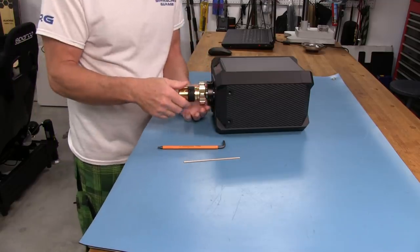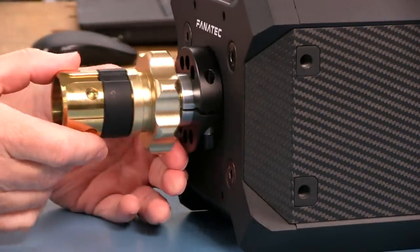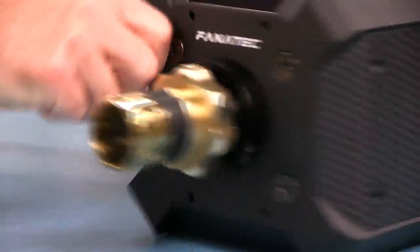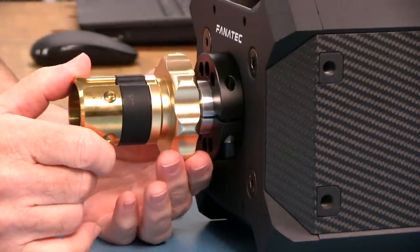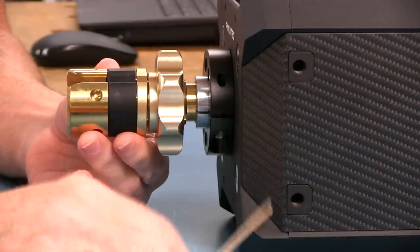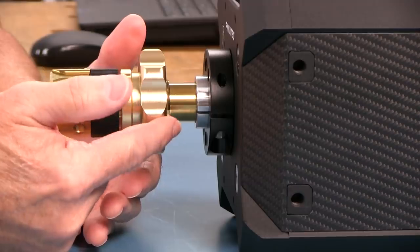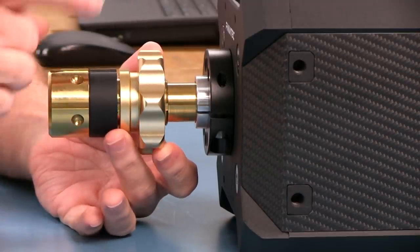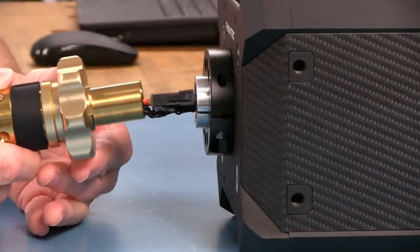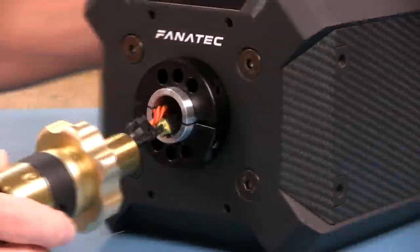Now it's loose — you can see this is moving around. Be mindful here: we're going to be encountering a couple of electrical plugs as you might imagine, because of the connection here for our wheels. So we gently slide this out. It's a smooth shaft, as you can see here as it's coming out. I can feel some spring back, and that's probably the wires in here — so this is something you want to be mindful of, especially if your wheel has turned around a lot; it may have twisted the wires a little bit in there. There are the plugs coming out, in a staggered plug situation so they'll fit into the hole.